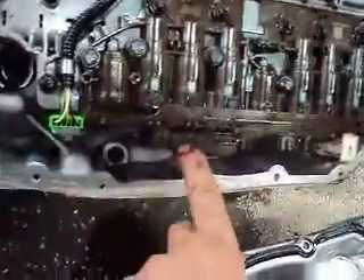So the first thing I did was bypass — unplug the TCM, which is down by the transmission. I've got a parts transmission over here. This is a 6L80. This here is the valve body, and what this is, is what they would call a mechatronic unit. The TCM is actually right here — it's part of the valve body.